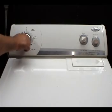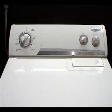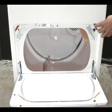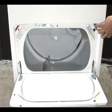If you turn the dryer on, push the push-to-start button and the motor starts running but the drum doesn't seem to be turning, open the door on the dryer, push the door switch actuator to turn the switch on, depress the push-to-start switch. If the motor starts running but the drum doesn't turn, the problem could be a broken belt.